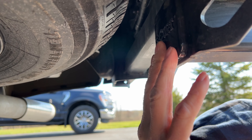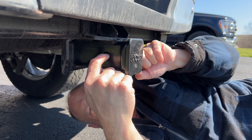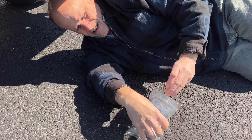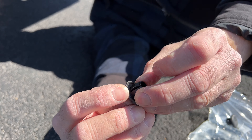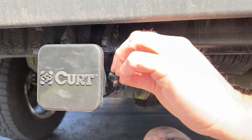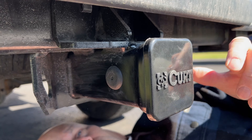Now I'm completely waterproofed — but not to be outdone. Simply because I'm going to keep the majority of water out, there's also the five-eighths inch pinhole on both sides. I do have a HEYCO product that I was able to find — I'll put the link up on where to get that. This is actually from my friends at McMaster-Carr. These are a plastic plug with little lock ears on it, but the interesting part is it has a flexible rubber seal. So all I'm going to do is stick that right into the hole and press it in. Same thing on the other side. They're nice and tight, but they also pop right back out again — you can pull them right back out. I believe they're going to keep out the majority of water from my receiver.